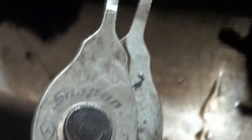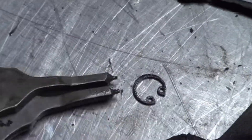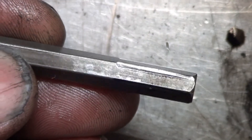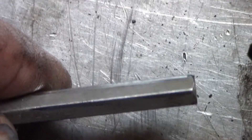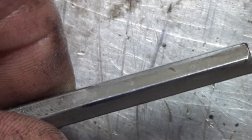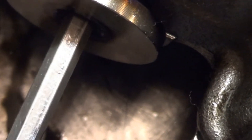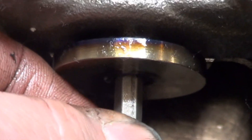With my snap-on snap ring pliers, it's not hard at all when you've got the right tool. Here's our hexagonal oil pump drive shaft, and you can see a significant amount of wear there. The other side that rests in the oil pump doesn't really show wear — it's a little shiny on the edge but not really worn. It looks like it has a much longer area inside so it spreads the wear over a much larger area, whereas this side has a much shorter contact area. There's a lot of movement — it wiggles pretty good. Other people have experienced a stripped pump drive resulting in no oil pressure, probably losing the turbo, probably losing their engine quickly.